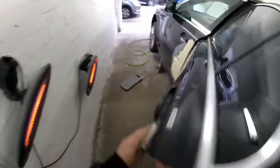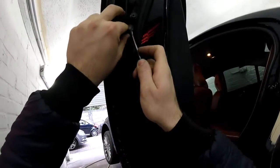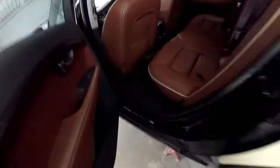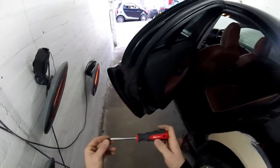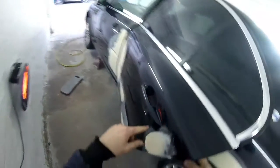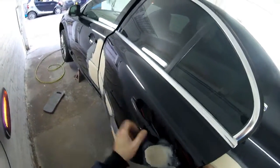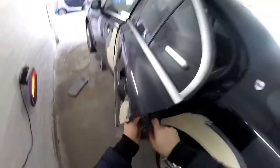I'm going to open the door. We have to identify — here we have this plastic cover, which we have to remove. We're going to need a small screwdriver and a screwdriver with a Torx 20 or T20. Inside this hole you're going to see the screw which is holding this plastic cover. So we're going to have to unscrew it.